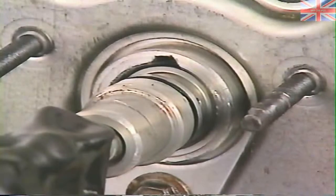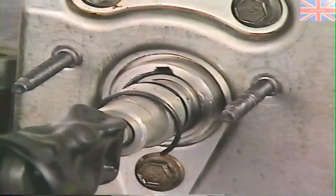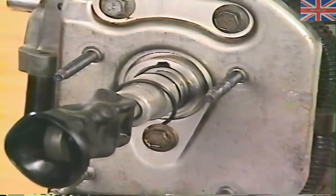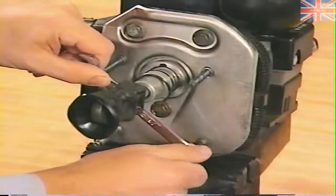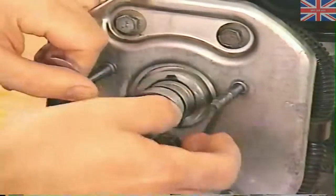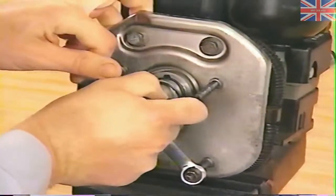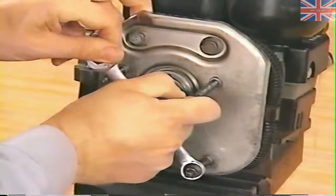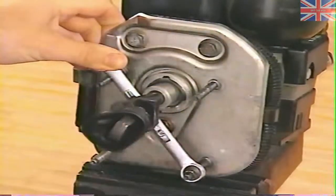When the piston assemblies are in as far as they'll go without much force, place a new snap ring over the master cylinder input rod bearing. In addition, the box end wrench and nut should be reinstalled in the same position as before. Then push on the piston assemblies to compress the springs so the snap ring can be installed. Secure the piston assemblies and input rod bearing using the box end wrench. The shoulder of the bearing should be in past the snap ring groove.